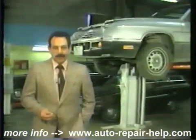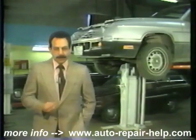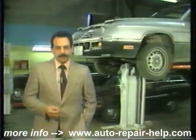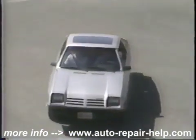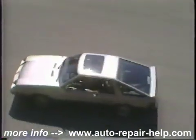Should your customer describe a clicking noise on turns, vibration or clunking on acceleration or deceleration, or mention a broken dust boot, explain the necessity of prompt repair. Should the vibration become excessive, it will often cause extensive damage to the transaxle unit. A short road test with the customer is advisable to verify any noises they may be concerned about.